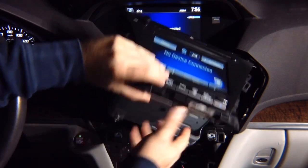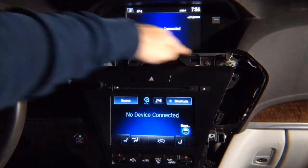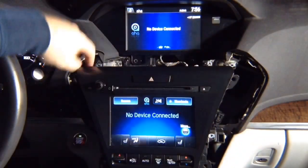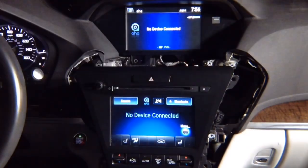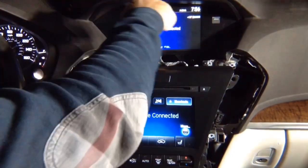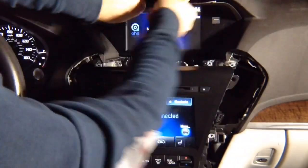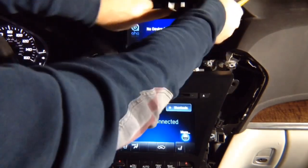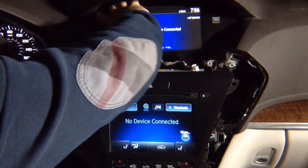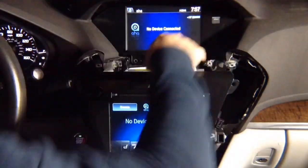Once you pull the radio out, remove two screws on top so this panel can come out — it just pulls out. You've got two screws holding the screen — they also have to come out. Remove this panel on top — it comes out forward. Nothing is holding the panel, it just comes out. There's one screw on top, and you can release the screen to access the connector. That's the entire disassembly — three screws are on the screen: two on the bottom and one on top.